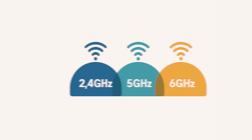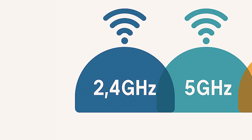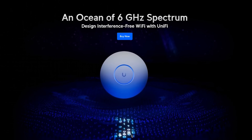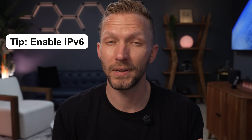Regardless of which system you choose, there are some key things to think about. First, Wi-Fi bands — you'll want both 2.4 and 5 GHz bands. Most smart home accessories connect over the 2.4 GHz band, while some devices like cameras, thermostats, and streaming devices may use the 5 GHz band. Newer systems also offer a 6 GHz band, which is great for future proofing. There are also notable performance improvements to the 2.4 and 5 GHz bands with newer systems like Wi-Fi 7. Also make sure you have IPv6 enabled on your network, as it's required for Matter smart home devices — something we'll cover more in the next video.